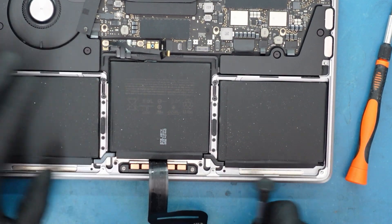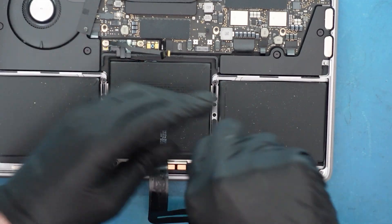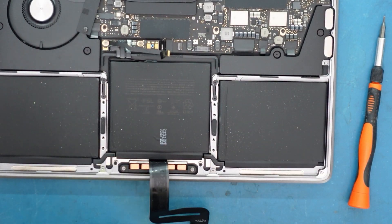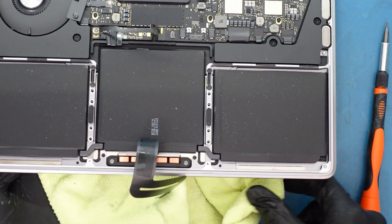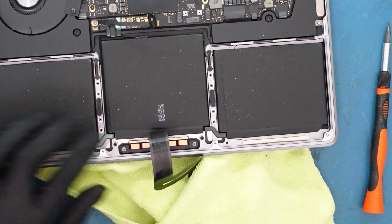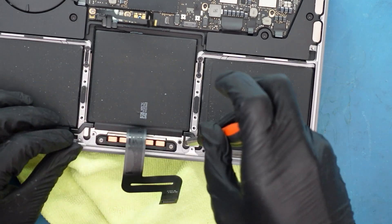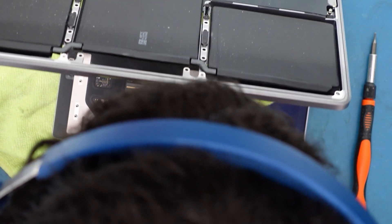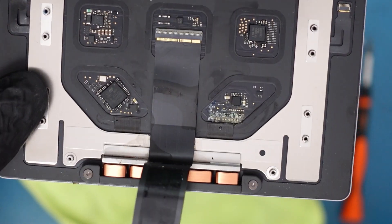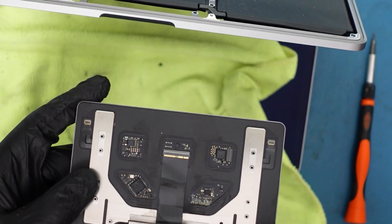I'm going to lift this up — it goes all the way. Now we're just going to be doing each screw here on this side. Place a towel before we totally let this one go so it's not going to damage the screen. If there's any dirt or liquid or something, you want to make sure that you put a little towel under here so it's not going to get all over the screen. And here you go — you can see all up here there's corrosion, how nasty it is, all that blue nasty color. And you can see the cable's been a little bit impacted.